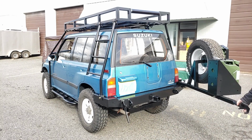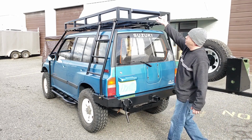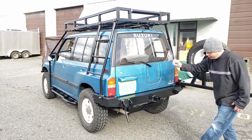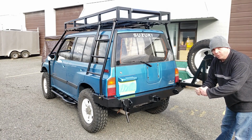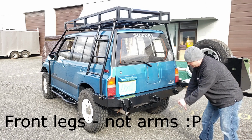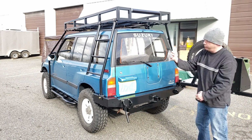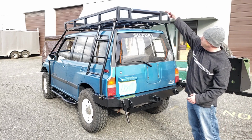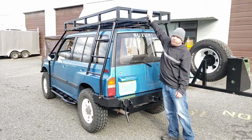It locks itself into 90 degrees automatically. Then he'll take that winch cable, he'll pull it down. He'll take a tree saver strap, which is about a 3-foot long nylon webbing strap, and he'll put that around the animal up under its arms, put the loops together, put the winch hook through that, and then go ahead with his winch control and winch the animal up into the basket over this 24-inch wide heavy-duty conveyor roller.